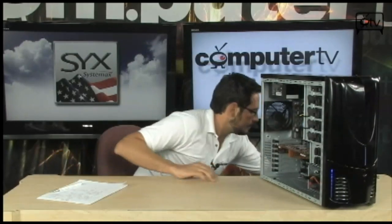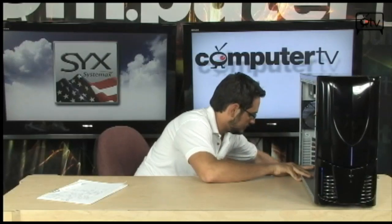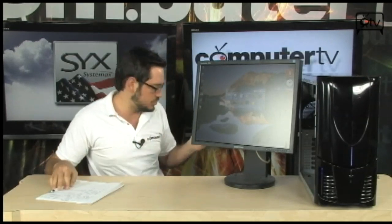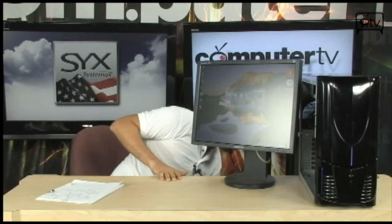And just to show you a very basic demonstration of the type of power that you're getting off of a P55 system. Again, it's the type of system that brings the performance of Nehalem, of the microarchitecture, of all the new stuff, but it's making it more affordable, and it gives you the same type of performance. I'm going to run a benchmark called SuperPi, and most Core i7 systems do it in about 12 or 13 seconds, depending on how fast they're clocked. And I'm actually going to throw it on here just to show you that there's barely any difference.